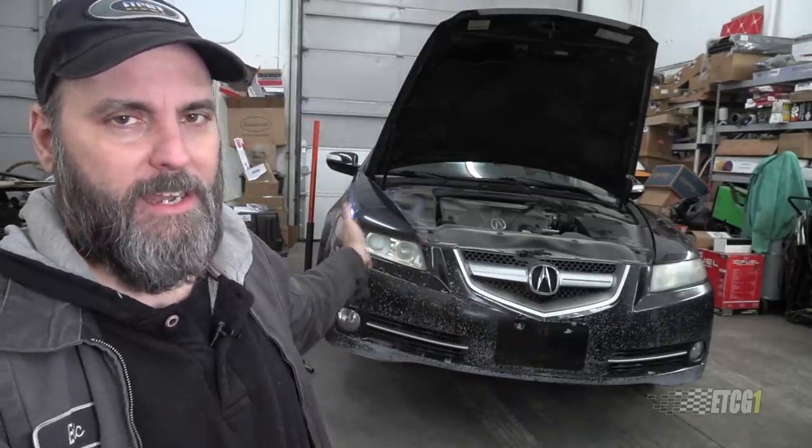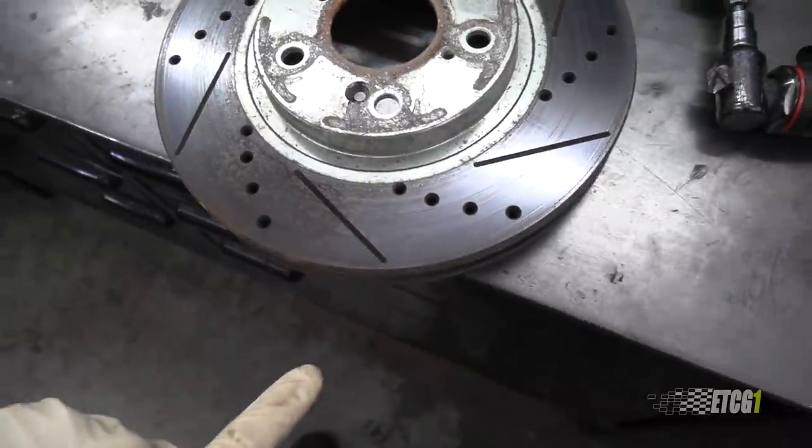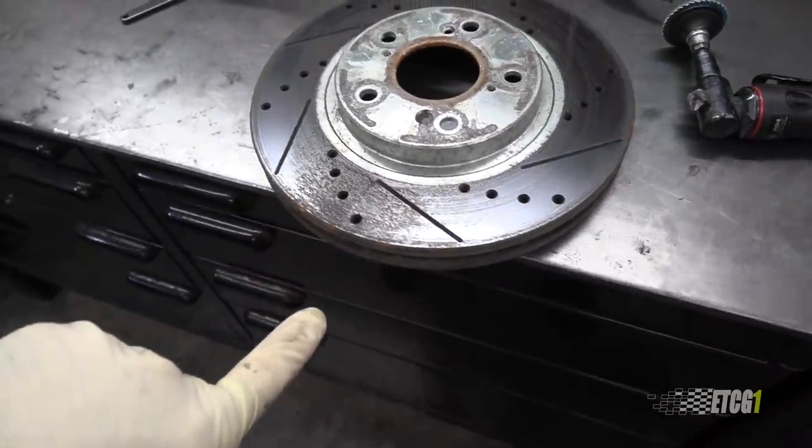As far as the way it runs and drives, I really haven't had any complaints, but as I said, it's been doing a lot of sitting. In fact, that's why it's the way it is right now — because it sat, the rotors got rusty. So when you go to move it after that happens, what can happen is there's a brake pulsation, and this has a brake pulsation which I'm hoping to address today.